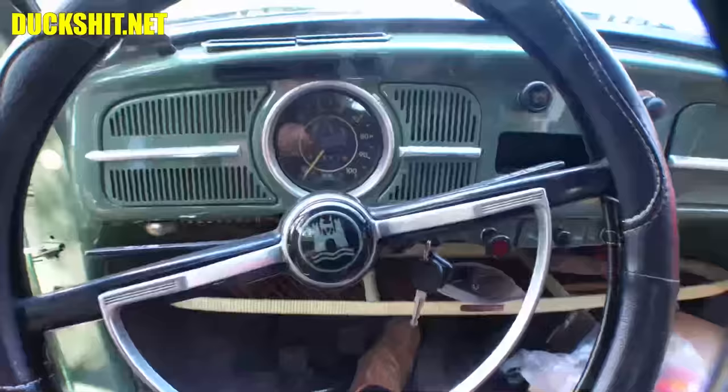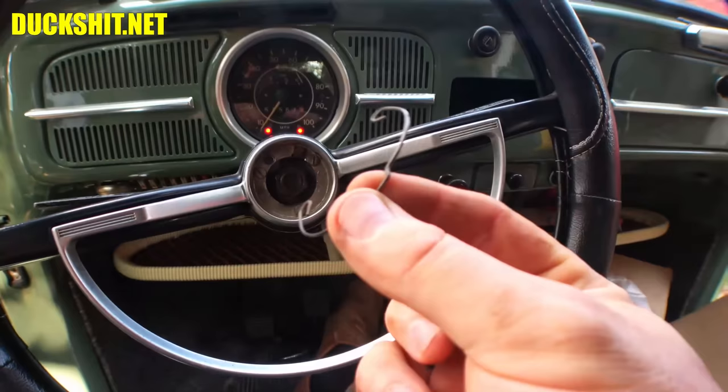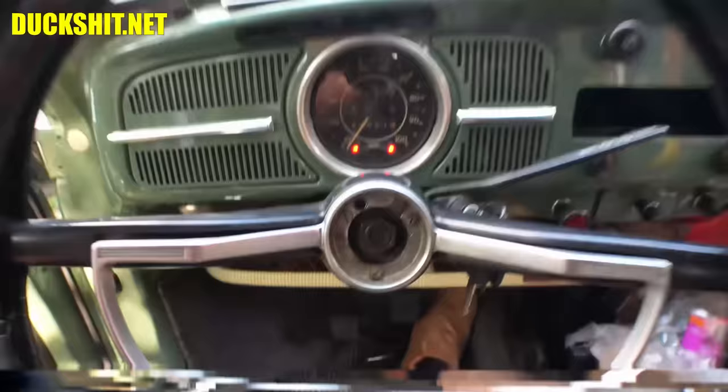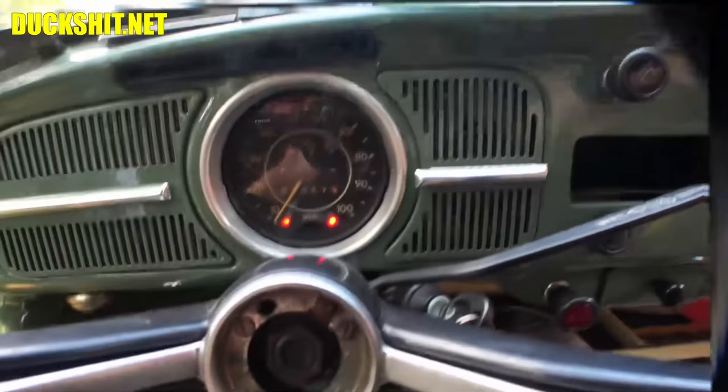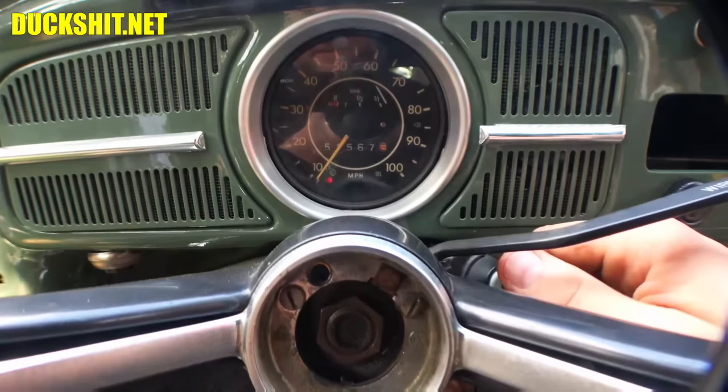If I got everything correct, we should have an oil light. Oh, look at that. And now — whoa, what just happened? A horn button shot out at me. That's got to come out anyway because we've got to replace the ignition switch, so I've got to remove that nut. I guess we skipped a step, or the car was just excited — it's a Herbie thing. Anyway, the oil light's working. If I hit the start button, the oil light should go out. Yep, there they go. Fantastic. If we turn this off, it should show an oil light again and a generator light. Dual warning lights — that's what it's supposed to do. That's what it didn't do before.